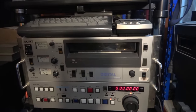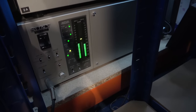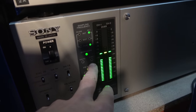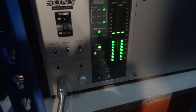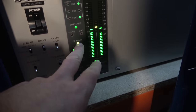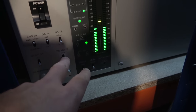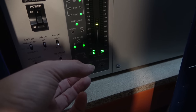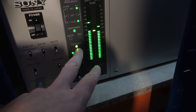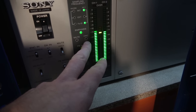This tape has plenty of errors on it, but let's just play it. We are getting errors from time to time - that's to be expected. We have the RAR function, which means it should be using both channels, but only A is lit and not B as well, which I don't really understand. RAR is lit and we are getting errors, but that is absolutely normal for the format.